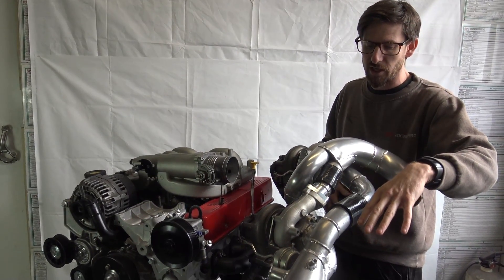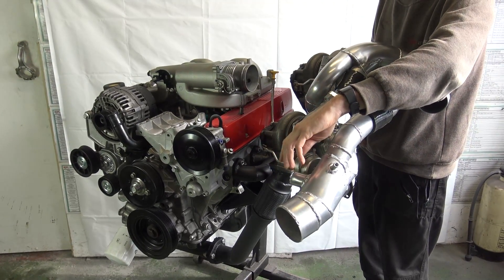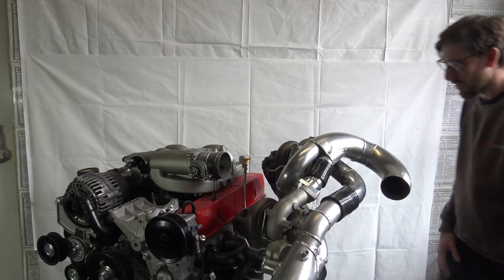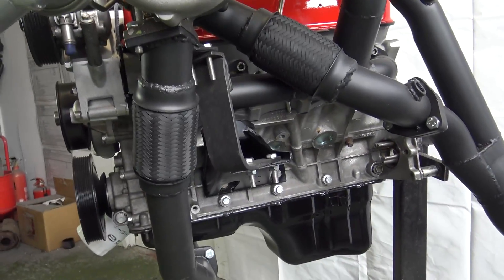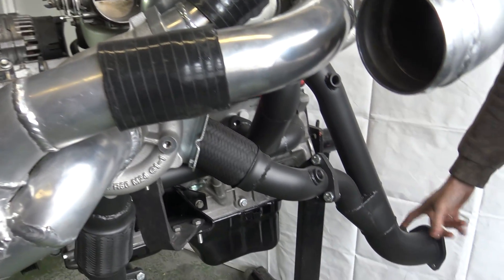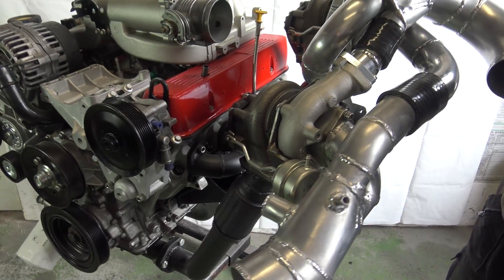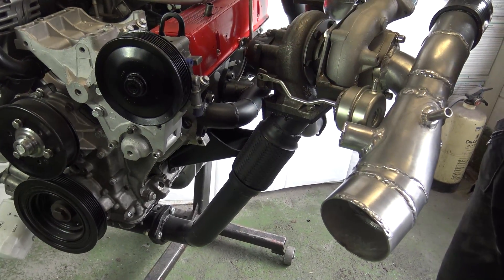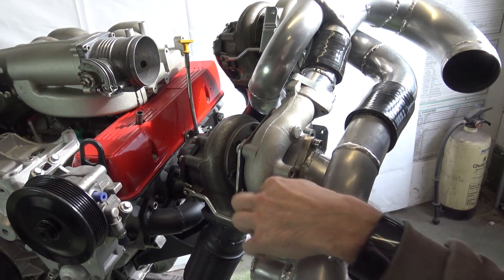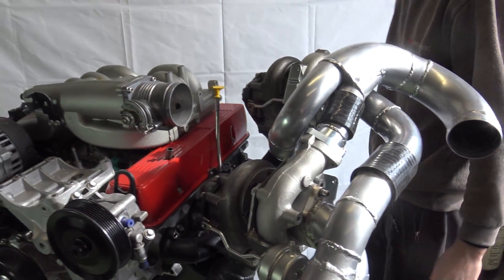So, a bit of a recap: there's a charge cooler to go on here, which then loops around to the intake plenum. We've got the MAF on here with air cleaner obviously. This is the pipework for the recirc valve, which pipes up to the charge side. The ceramic coating on the exhaust manifolds has come out really, really nicely - really pleased with that. We've got all the Lambda ports in here - the offside Lambda, nearside Lambda, and I've got a Lambda port down here for tuning for the wideband. Everything's bracketed off. This turbo, fed from the driver side manifold, is actually on a support bracket down here off the engine mount. I actually clocked this turbo as well - rotated it round and made up a new bracket, still got to paint it, for the actuator. Getting the preload on that exactly the same as the original was quite interesting and fun.